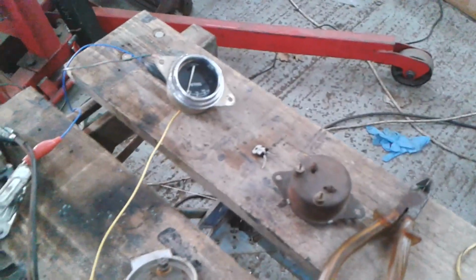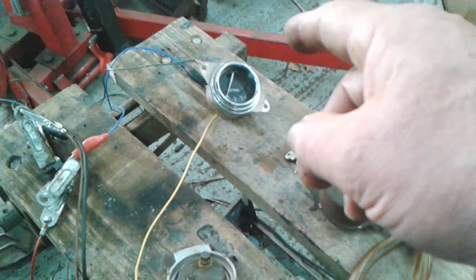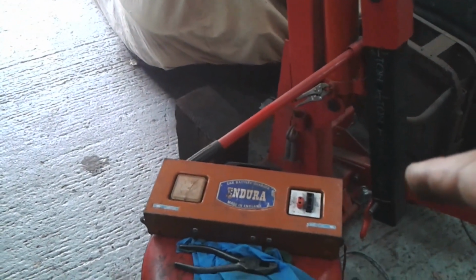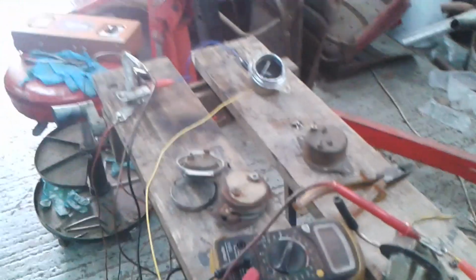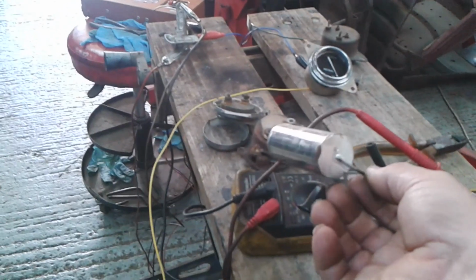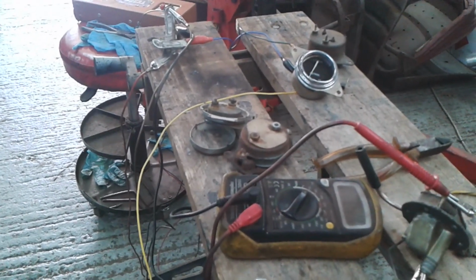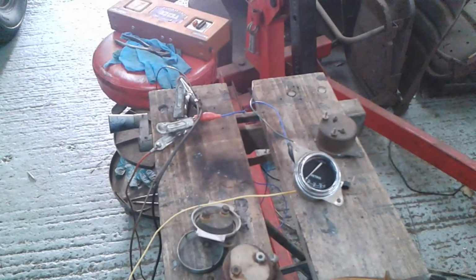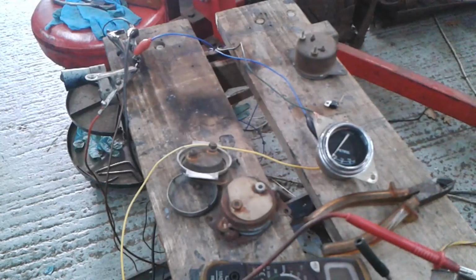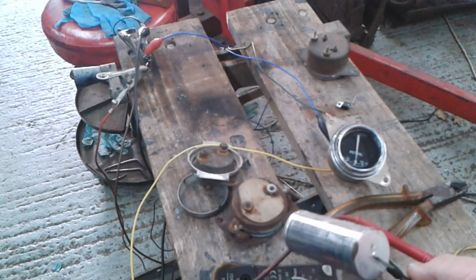Hello. Look, there's a Ford pop fuel gauge. There's an old-fashioned battery charger on 6 volts. Here's a sender. I tried for ages to get it working, and in the end I reversed the terminals. So when that's empty, that reads 0. Then when that's full, that reads full. But that certainly works now.